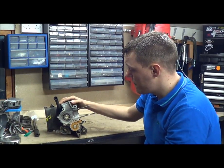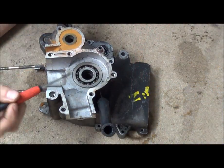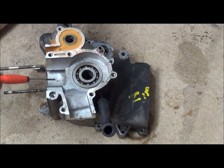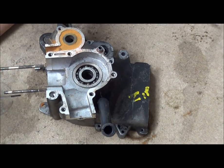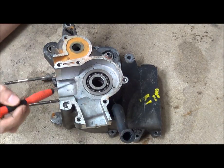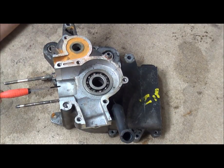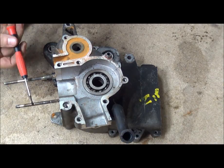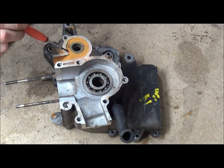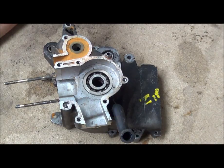So we're at the bench and this is the transmission side of a Piaggio Hyper 2 engine. These are fitted to a lot of modern day mopeds nowadays - Gileras, most Piaggio Zips, that kind of thing, Derbys etc. Inside here lives the crankshaft. We've still got the main bearings in this so we'll have to pop them out, and the oil seal on the backside. And then you have the opening for the cylinder, the studs - one's snapped off, fantastic - and then we have the water pump housing. This is off a Derby GP150.